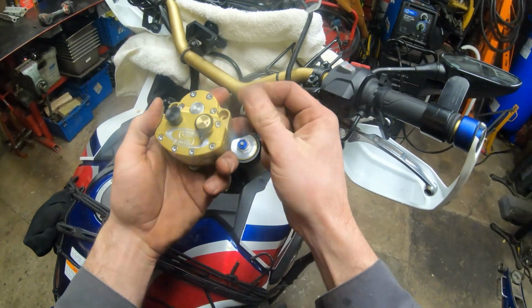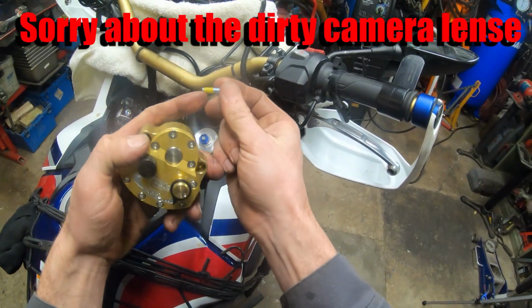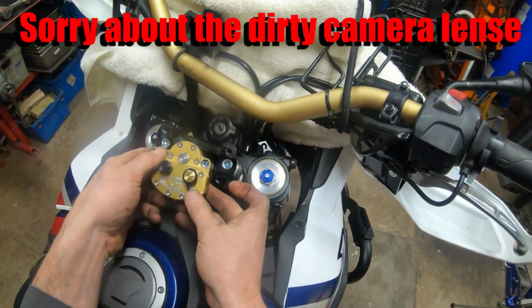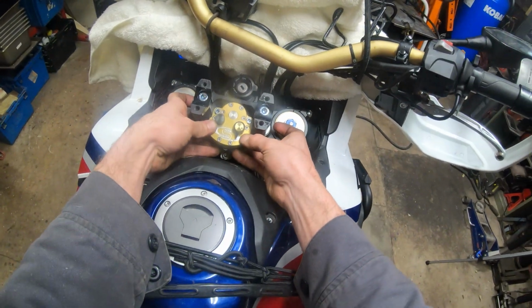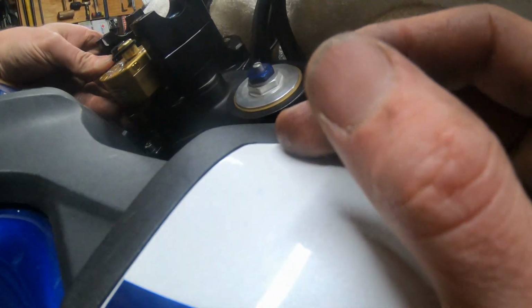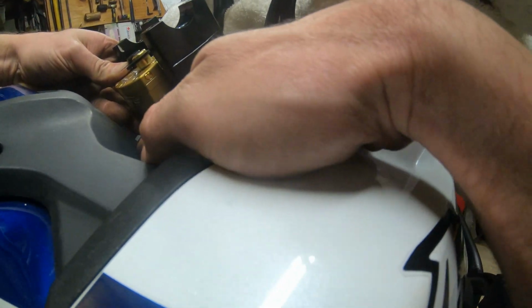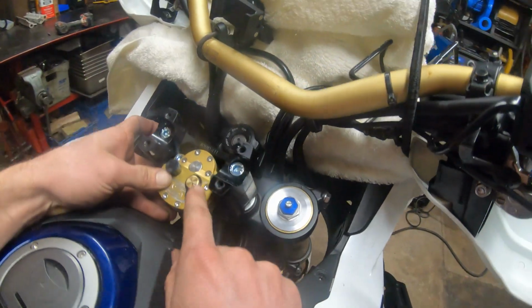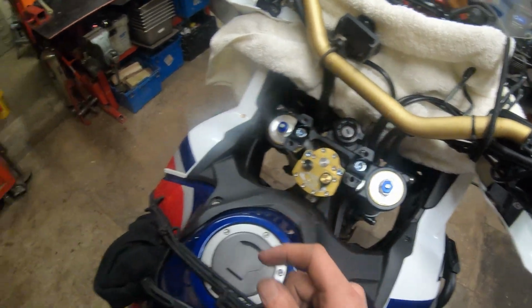And then we can bolt the stabilizer on. It does already have Loctite applied. And drop those in. And oh boy, how is this gonna look? Oh, beautiful. Just make sure when it goes on, it's nice and flush and that it sits on this bracket and it's not bottoming out or anything. And then snug those 5 mils down.